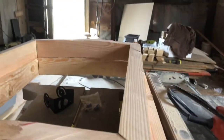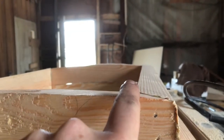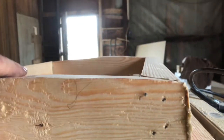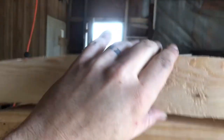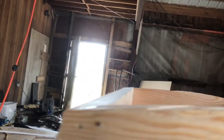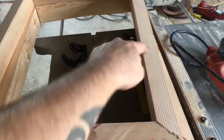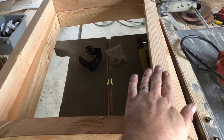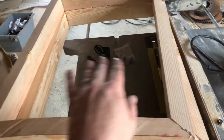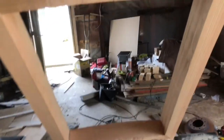In order to follow the proper curvature, I cut the right angle into the top and into the bottom of this two-by-four that goes across, so that this frame will sit flush against the roof. I'll screw into it from the top, then the Lexan glass will go up across this on top of the bus with sealant, the sheet metal will be in between these two with sealant, and we'll seal all the edges. When we go inside the bus, this will be the bottom side and we'll use trim to trim out the inside of this frame so that it looks really nice.